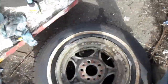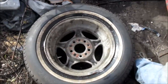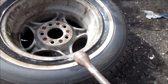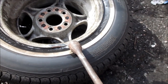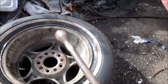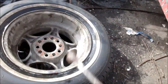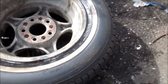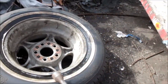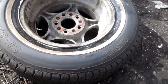We had one over here by the weight — you can see it's bubbling up right there. You just take a mallet, or in this case a lug wrench, and just kind of pound it so that it reseats. It looks like it's still bubbling a little bit right by that weight.